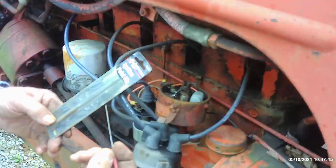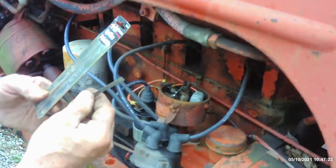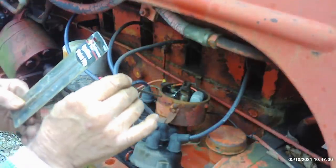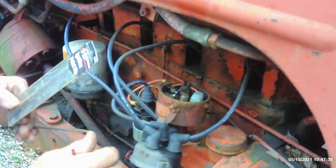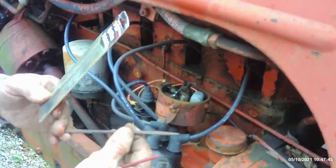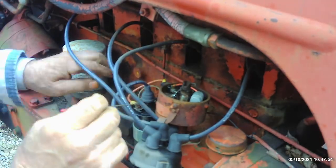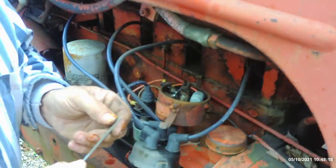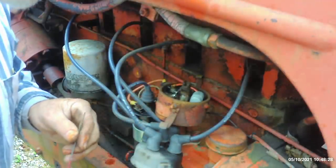This is a file probably 10 or 12 years old — it's got a lifetime warranty, but it's a performance tool ignition point file. The thing about it, it's a very fine file and it's perfectly squarely ground so it doesn't have any taper to it. If you have a taper to it, you're going to change the surface angles of your points, and you don't want to do that. You want to keep those things perfectly flat, and you don't want to excessively file them to grind the material away. You can also use a nice squarely ground machinist file as long as it's very fine. I'm going to have to check the point setting, and I've got to figure out what the point setting is supposed to be and get this on the upper lobe and set those points.